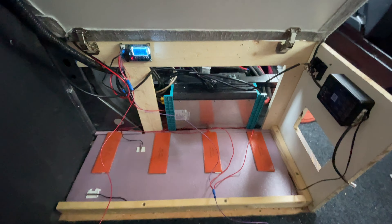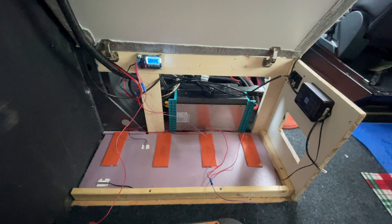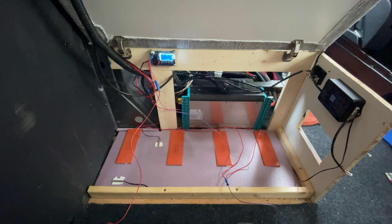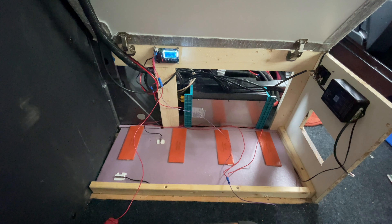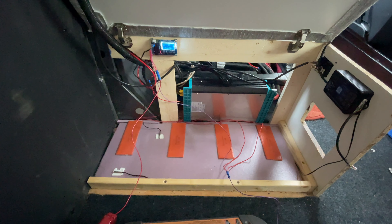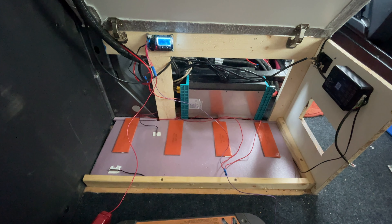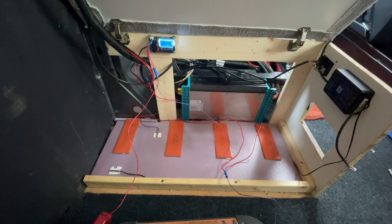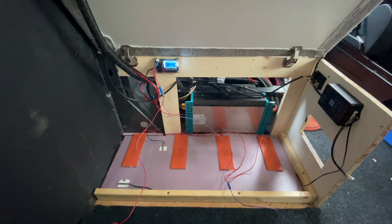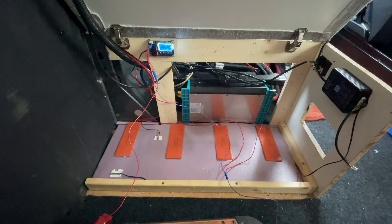Here's the battery box with the battery removed. When we got to a few days of real cold — like 17 below — it stopped charging. I checked the specifications; the manual said you could store it down to zero but operate it down to minus 20. I've since researched lithium iron phosphate batteries — operating means discharging. You can't charge them below zero; they get lithium metal collecting all over the anode and basically wipe out the battery life very quickly.